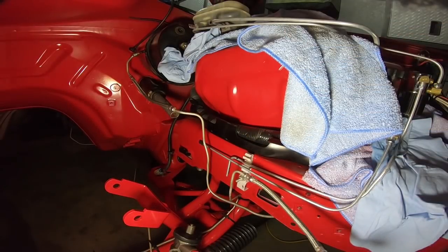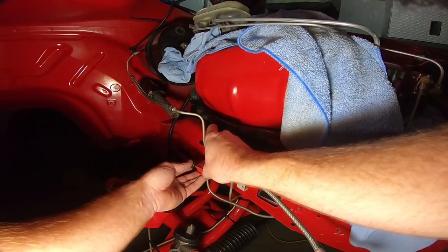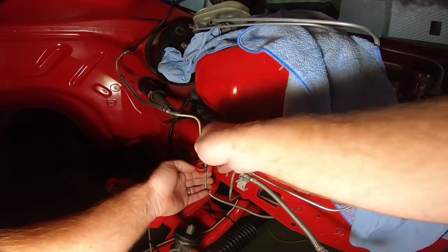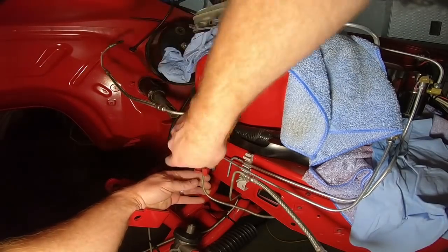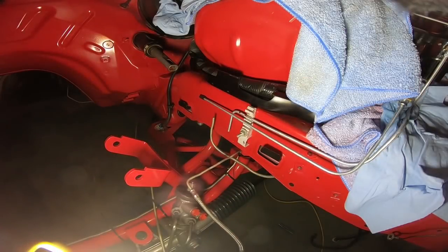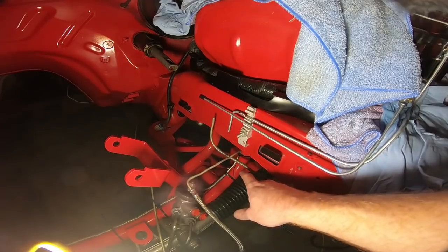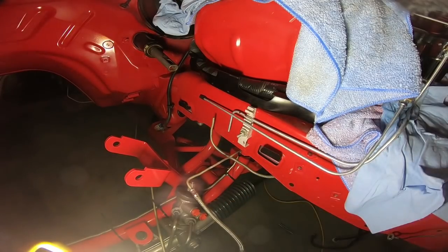I've bent these lines down just about every which direction and I think we're at a point where we're going to go ahead and cut the ends off — which means we're super committed. I'm just using a regular cutter. You just want to make sure you're real careful — you don't want to pinch too much, just a little bit at a time. The next place I'm going to cut is here. You can run it a hundred different ways, but this is just the way I've chosen. I kinked that line trying to bend too much, so I'm going to have to undo this and cut right where I kinked it. Worst case scenario you can go get some new brake line — it's not a huge deal.